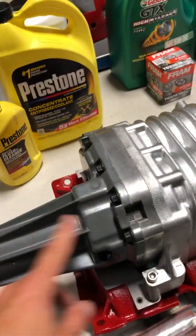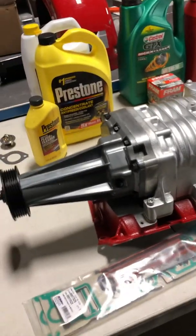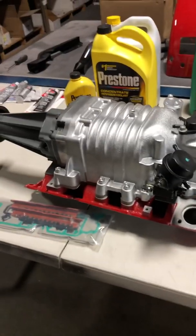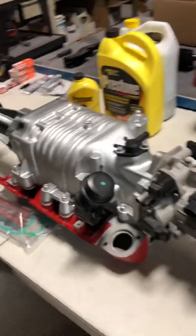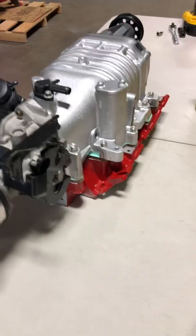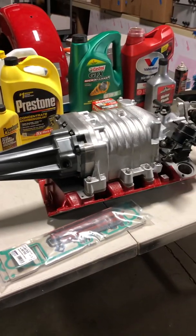This has been rebuilt — new bearings, new coupler inside. The gears look good, everything looks good. It's got new supercharger oil, which is a must. Anytime you get a chance, if you don't know the history of the car, change the supercharger oil — but you have to use supercharger oil. Don't use regular oil; it's not designed for it. And I painted the supercharger and the lower intake manifold, but that's just me. I'm a little bit about style as well as function.